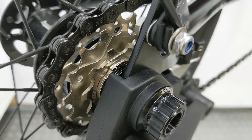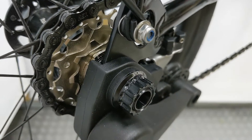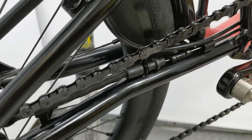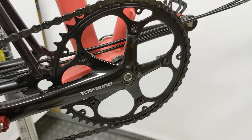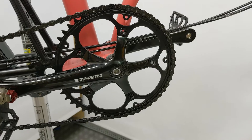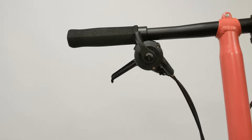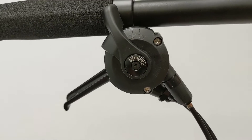The 12-point extension nuts here are optional. The bike also has the optional 50T chainring. By using the conversion parts, the post-2017 integrated Durella shifter, or the left side shifter, is converted from 2 to 3 speed.